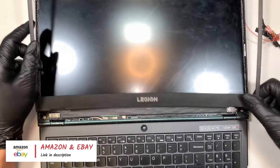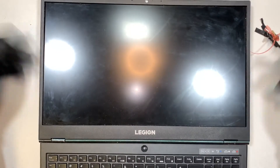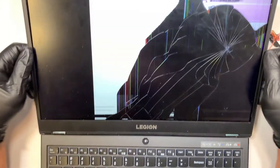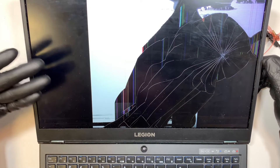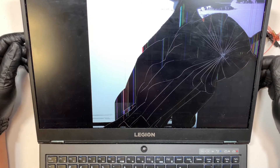Once you have that installed, go ahead and simply press the bezel back together, and there you should have it. Press power on and the laptop should power on and boot to the same screen. You can see the LCD turns on and it's trying to boot to Windows. We did shut it off without a proper shutdown, but it boots to Windows.